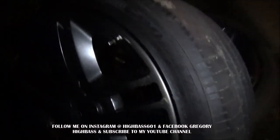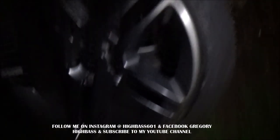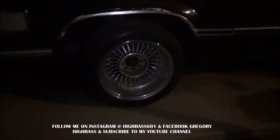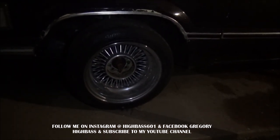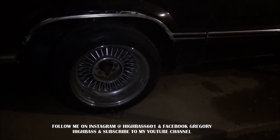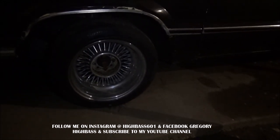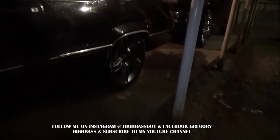These right here are 255/40 18s. So 255/40 18s in the front, and 255/35 19s in the front and 285/35 19s in the rear. Both of the rims are 9.5 inch wide. That'll give me the wide stance I want in the back.